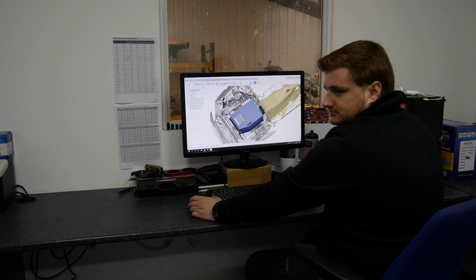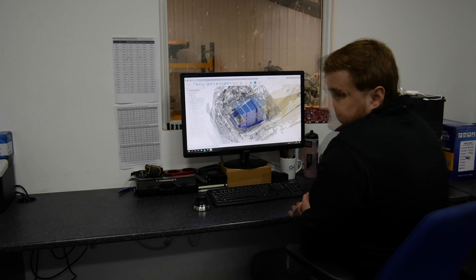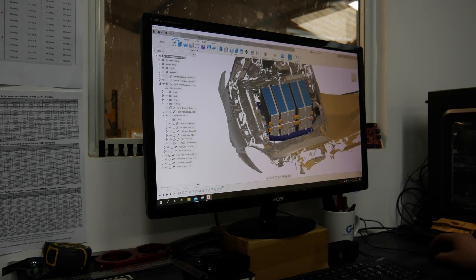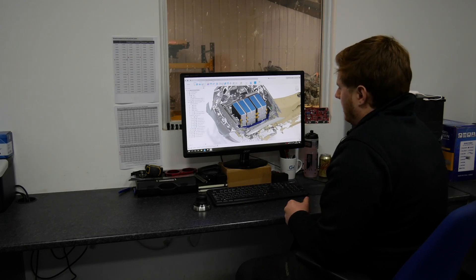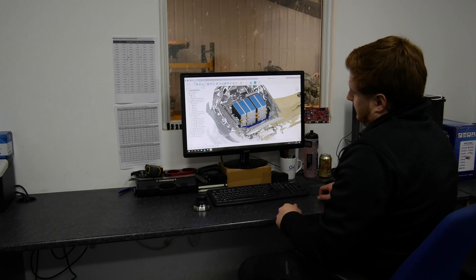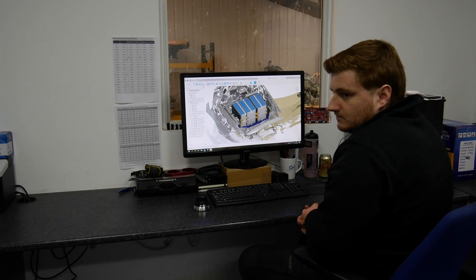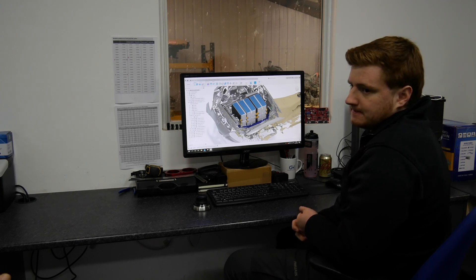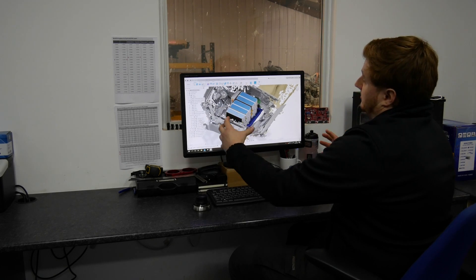Steering rack-wise we're clear. That's normally one of our biggest issues with most of the builds we do - the steering rack or steering box ends up getting in the way. But looking at that, we've got plenty of room. The battery box will be built on our battery jig downstairs - pre-built, boxed, sealed as a high voltage unit, and then dropped in. There's no building of anything within the vehicle. It can all be pressure tested for the coolant system as well. So we've got our own jigs that we can adapt - coolant plates, the modules on, everything ready to go. With this car we'll have motor, controller and gearbox mounted to one plate that'll go in as one piece. And we'll have the battery box with the DC to DC and possibly the charger, and the BMS will be effectively a sub-assembly with the battery box - that will go in as one.